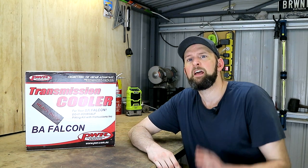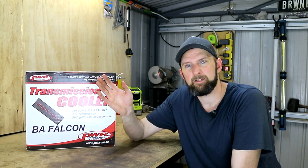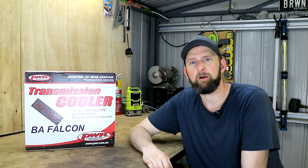There is one small trade-off to mention before we finish up. The factory cooler is attached to the radiator, which means it also speeds up the process of heating the fluid and getting it up to operating temperature, because it has the coolant right next to it. Now, that may well be true, but most of us drive our cars with a slightly cold gearbox and slightly cold coolant — we don't all wait long enough to warm everything up. Most of us just jump in and drive away. That coolant still takes time to warm up, and your transmission fluid still takes time to warm up regardless. So just take it easy for a while — it lets your fluids come up to temp, and modern cars are built to be driven like that, so I don't think it should be a big issue.